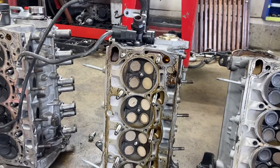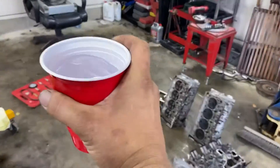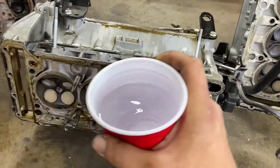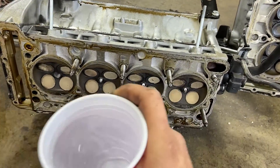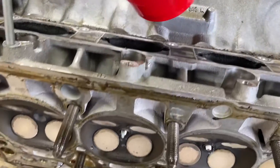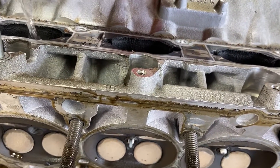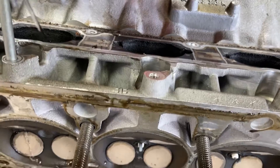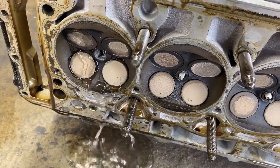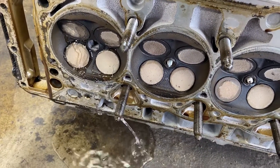To prove that, I'm about to flip it over and leak test it with water. I just have some basic water and it's tilted up to where the intake valves are. Typically you're going to bend the intake valves — we'll talk about that in a second. I'm going to carefully pour it into these intake ports without spilling. See — just dumping out. They look perfectly seated, but they're obviously not. So you cannot trust your borescope.